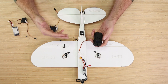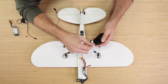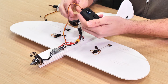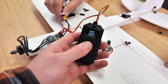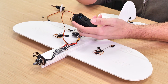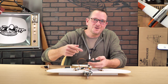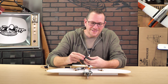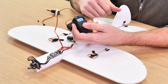Along with being able to center your servos, you also have the ability to detect which way your motor is going. All you simply need to do is plug in your ESC. We're going to power it on, and you're going to notice our ESC says ESC off — it's automatically switching to ESC mode. When we hit this button, it's automatically going to pulse our motor at about 10% throttle for just a couple seconds. This gives us the ability to check our motor direction and make sure everything's working properly. And again, you can see you don't have to worry about polarity.